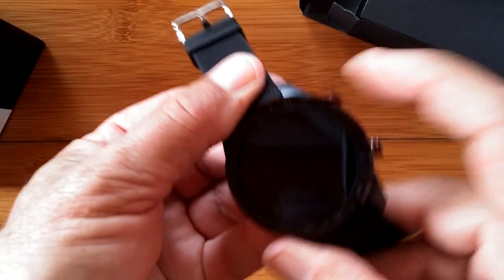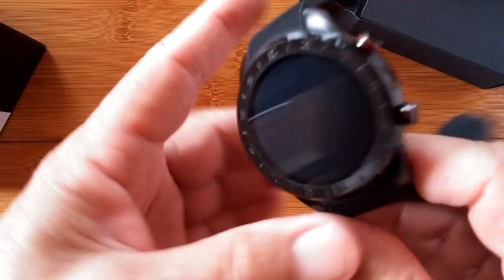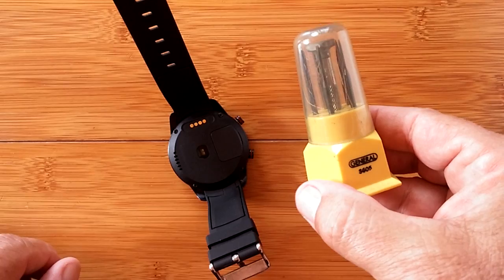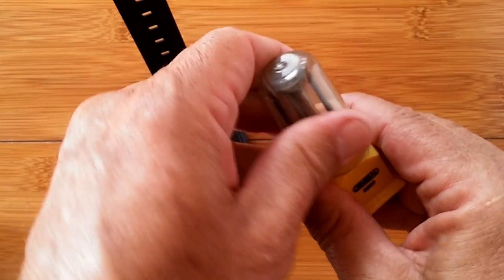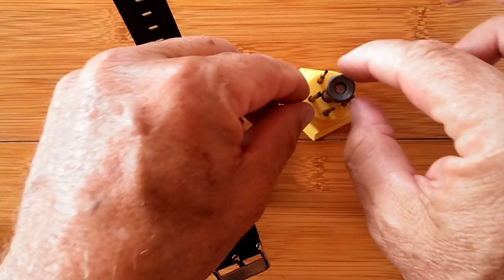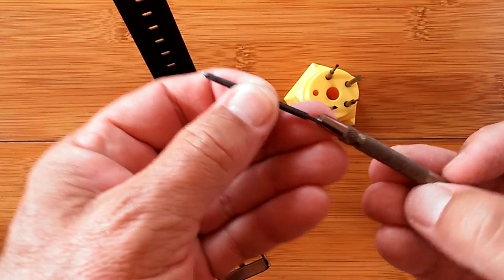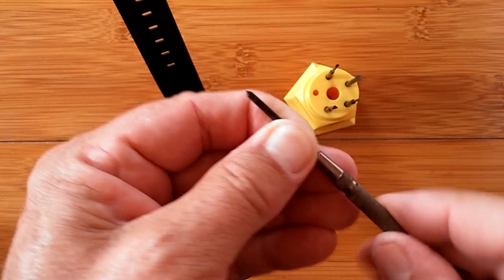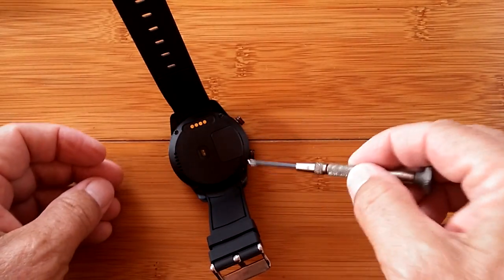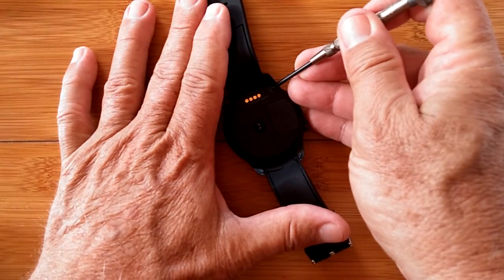But no activity — the watch isn't booting. So I'm going to clear everything out, set the studio up, and we are going to open up the back of this watch. I've got my little general screwdriver kit — a handy little thing to have. This is an easy watch to get into because it just uses a regular Phillips screwdriver. There are four screws on the back that let you get inside, so we'll take the cover off.